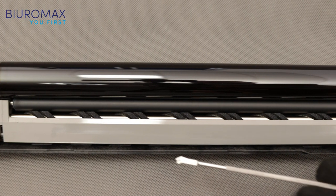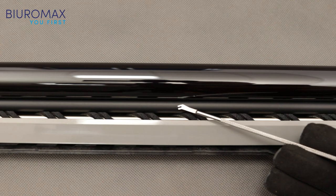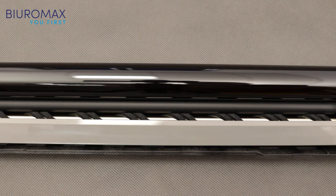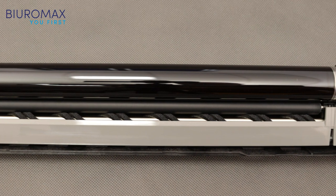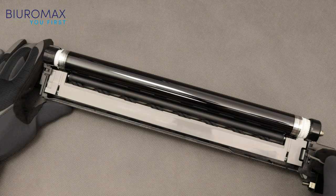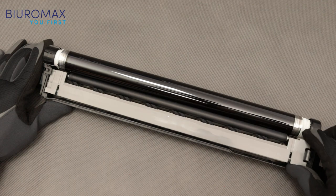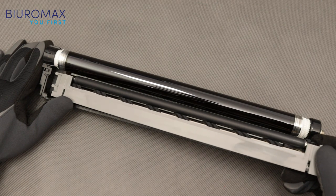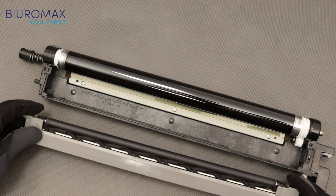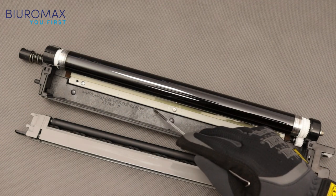Low quality remanufactured toners permanently stain the cleaning roller and charging roller. With these toners, the entire charging section is in perfect condition. We look under the charge roller for hidden dirt buildup. The toners do not dust — the charging section is clean on both sides and the housings at the cleaning blade are clean.